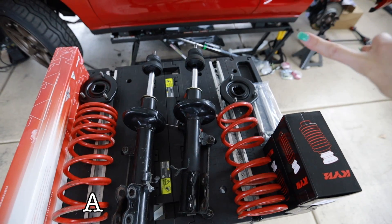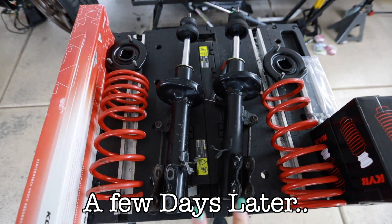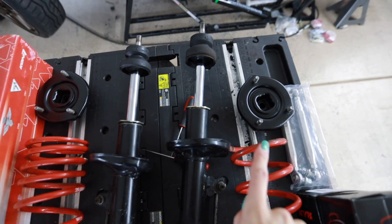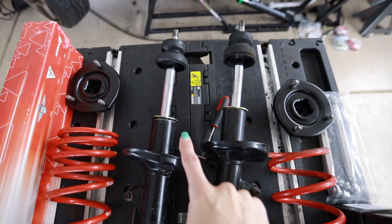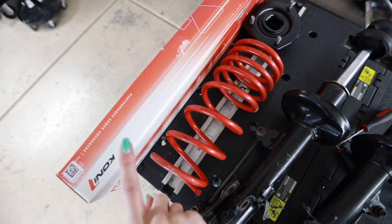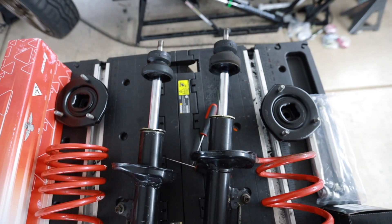Now that that's done, it's time to reassemble the rear suspension. I got everything cleaned up, cleaned up the strut bodies, I painted these top hats the other night, and cleaned up the rest of the parts. I need to pull out these inserts and put my new Koni yellows in there, then change out the bump stops and put fresh boots on there, as well as these rear end links. Hopefully this will be the last step — I'll have all the suspension bolted back together and the car can get settled down to the ground.